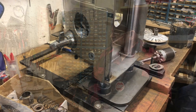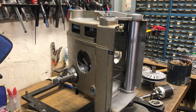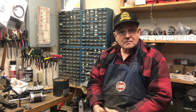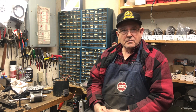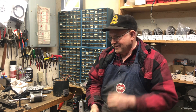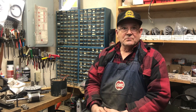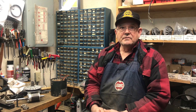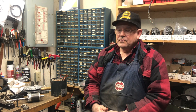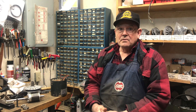So for this gentleman, I have a golden tan machine that I got from another customer who had put a Power Pro on it. It's been upgraded with all the newer features like a two-bearing quill and poly-V system. I said I'll get that one working for you — all you have to do is pay for the repair on that machine and I'll keep your other parts for spares. That's going to make him a pretty good deal. You're not going to have to pay seven to nine hundred dollars for a repair. A repair on an older machine with a lot of issues can be three hundred fifty to five hundred dollars, and then if you have a burned-out motor you've got to add another four hundred to four fifty for a brand new motor, which runs it close to nine hundred.